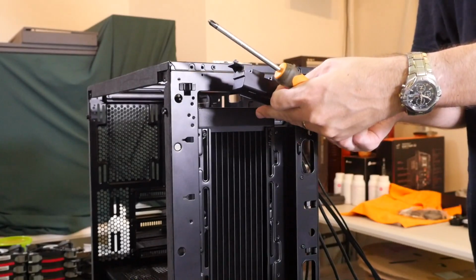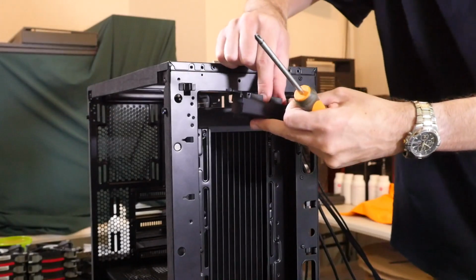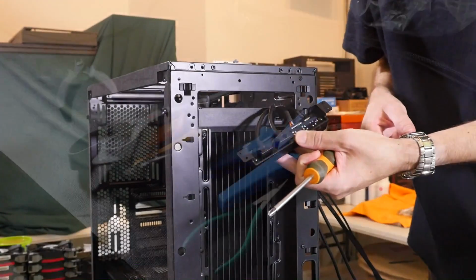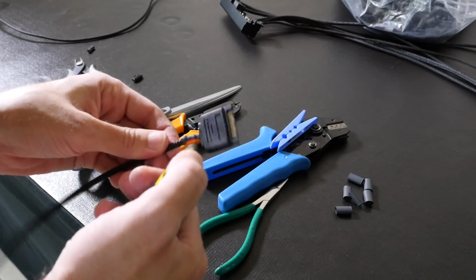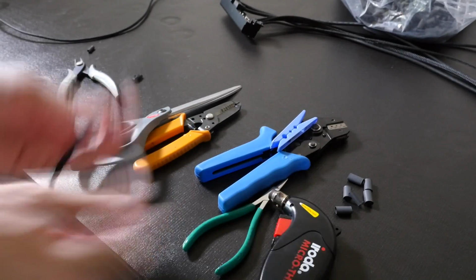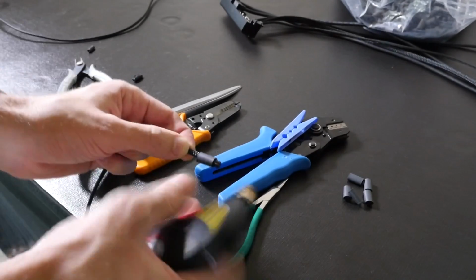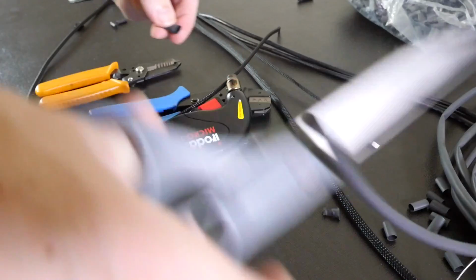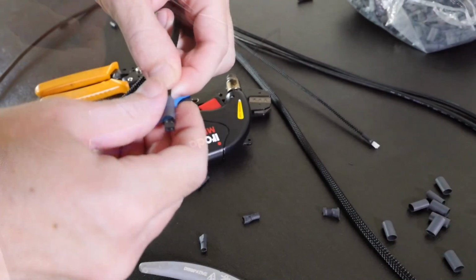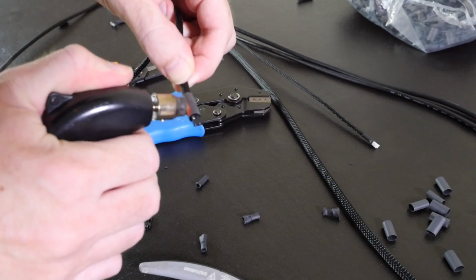But I don't actually plan out my loops until all of the components are installed, until the latest possible moment, right when I'm starting the loop. And then I get a feel for the components. I stick to the rules that I've mentioned many times before. Take the shortest route, go around in a circle, never cross tube. And it just kind of happens. I've done it so many times that I don't really think about it anymore.